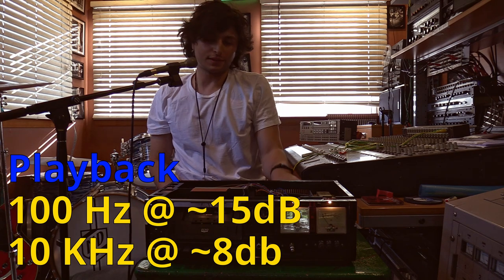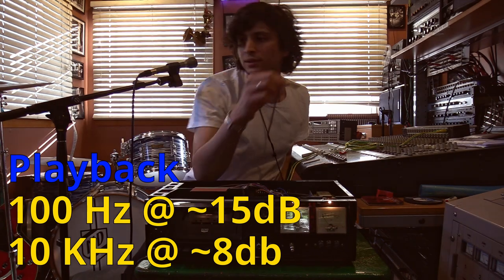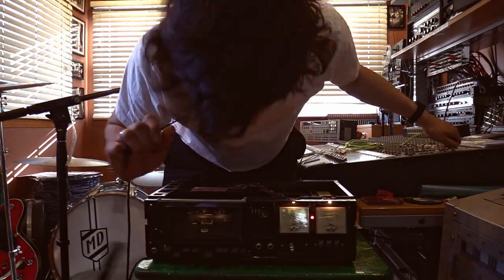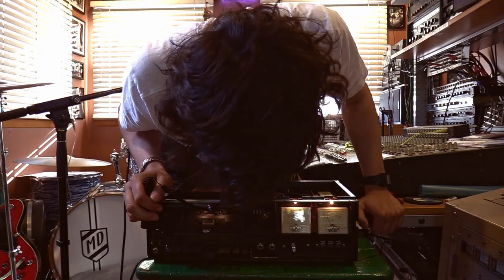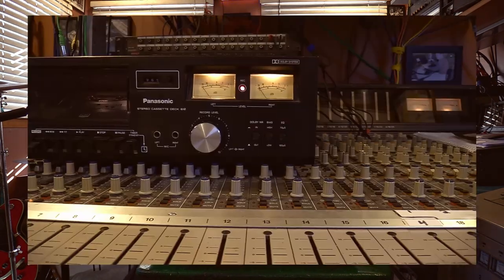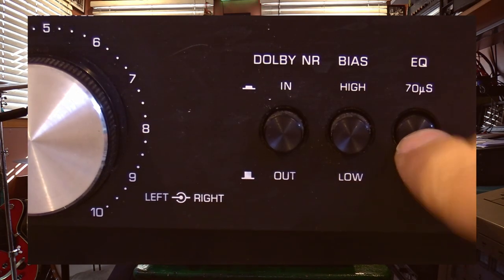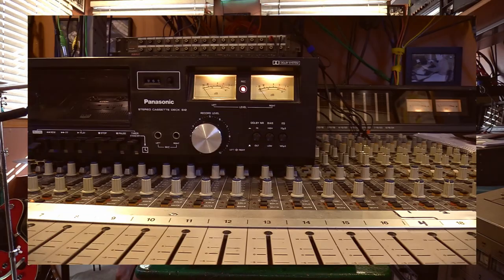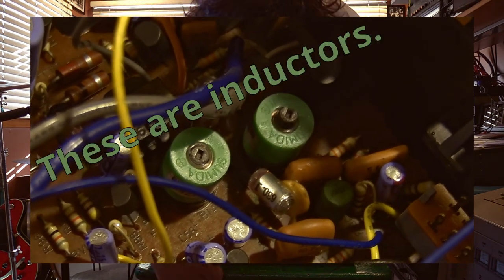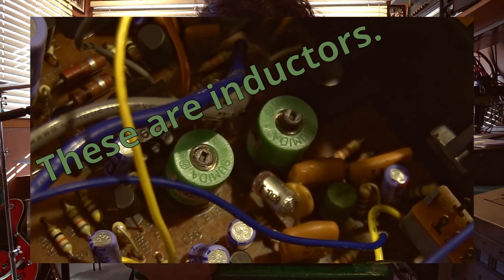I'm still getting similar effects, so I'll just keep making adjustments and hopefully start to see some results. There's something I'm realizing while editing this video that I did not realize when I was recording it: the adjustment I'm making to the bias is not actually changing the bias level of the recorded signal. The knob on the front of the cassette deck sets the bias signal to a preset value, whereas the adjustment I'm actually making is changing the inductance of the record circuit. The technicalities aren't all that important — the important thing is that I'm using this as a high-frequency adjustment for my playback response.